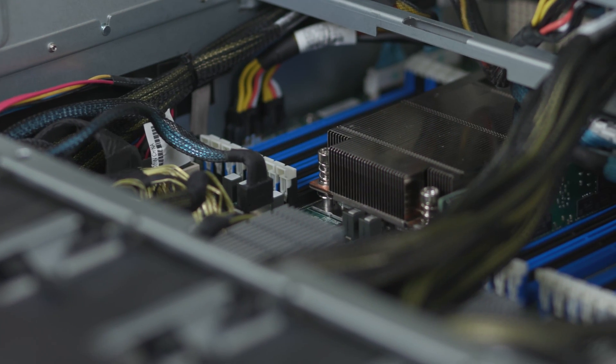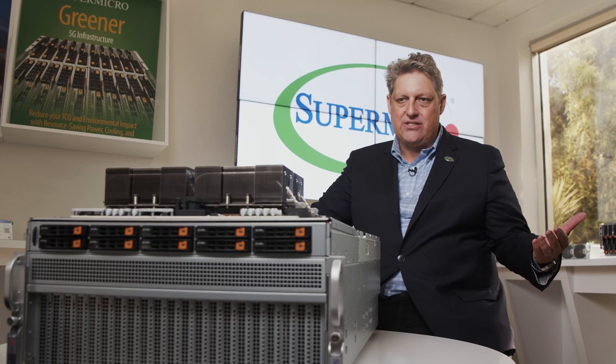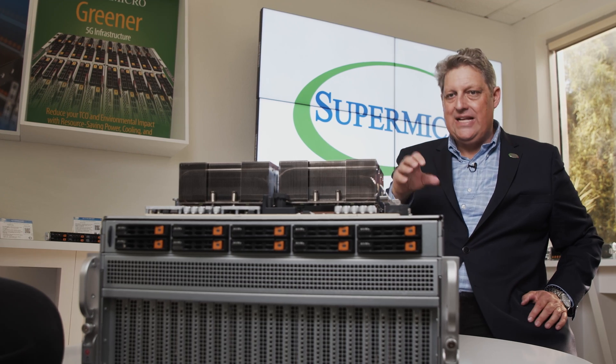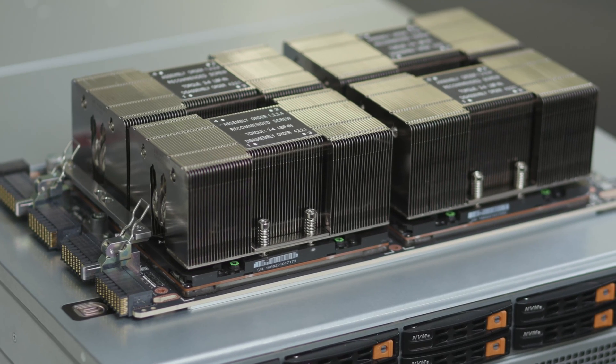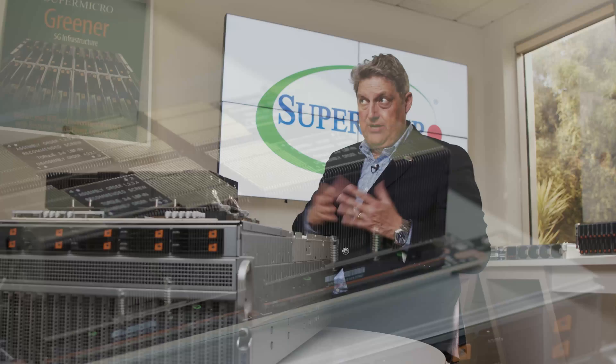You'll have a similar motherboard — they all have 32 DIMM slots, dual processors, and either eight or ten networking cards in the case of the 5U. One of the exciting things is we're going to be able to offer HGX A100 GPU by NVIDIA. It's available with 40 and 80 gigs of memory. We'll be running this with the third generation Intel scalable processors codenamed Ice Lake, available April 15th.